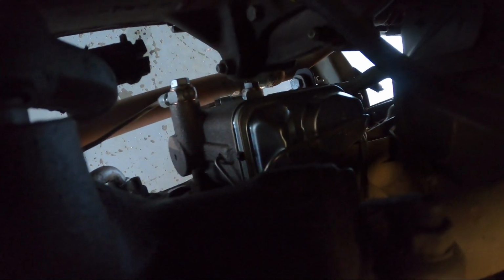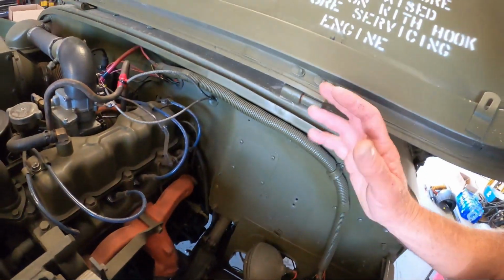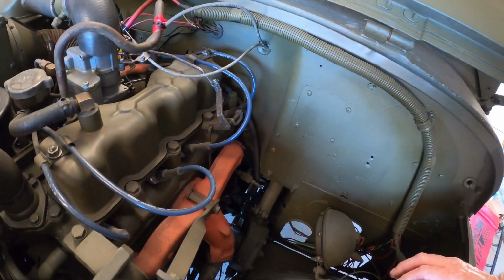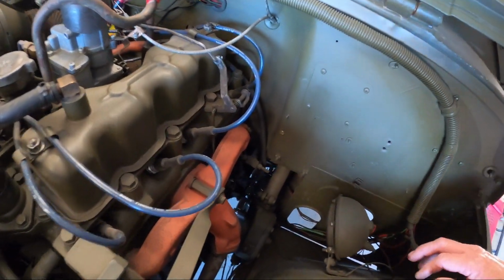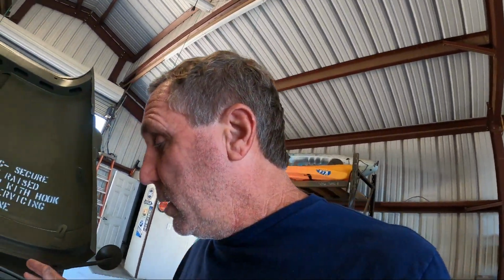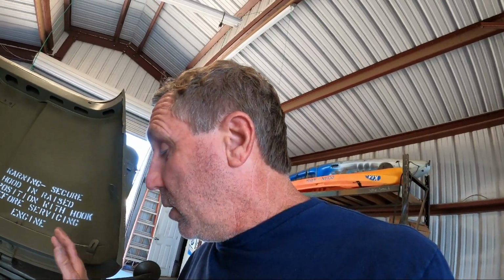You could kind of see it down here, you know, through the engine bay. That's the new master cylinder. When he gave it to me, I looked up in there and I thought, there's no way that's going to fit. But it's a really cool kit. You have to cut one bracket off the frame. Which, you know, you kind of hate to do that on something like this, but I mean, this is a great improvement for it, so it's okay. I had to cut the exhaust out of the way so I can get to it, drill a few holes in the frame and mount the new master cylinder in the bracket, and all that went really good. So I'll get some video of that when I get this back up on the lift.